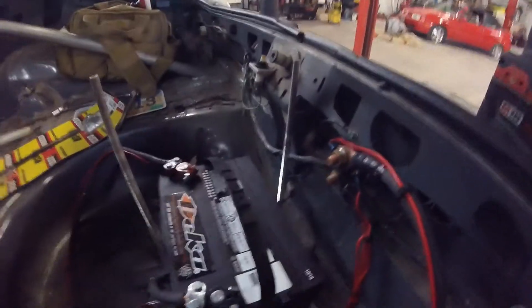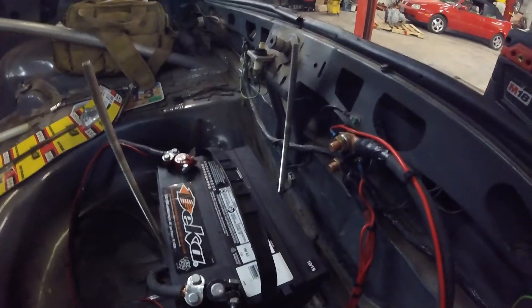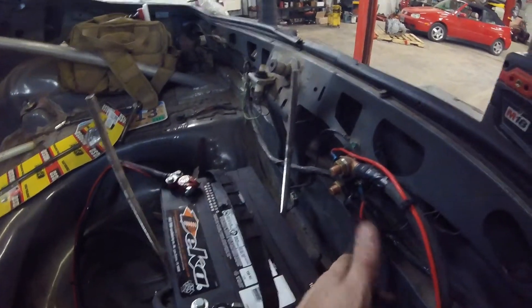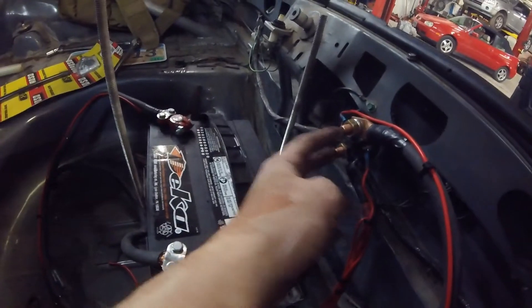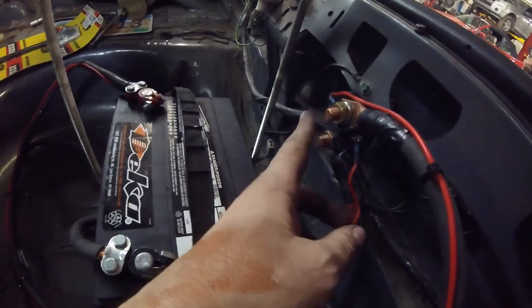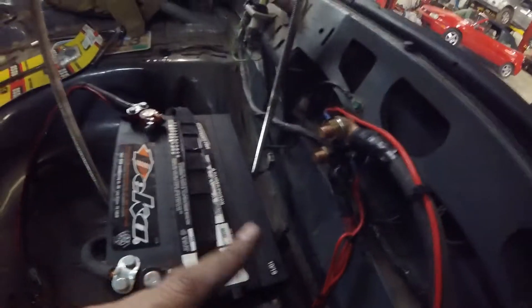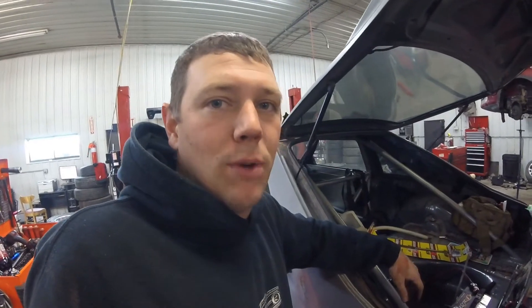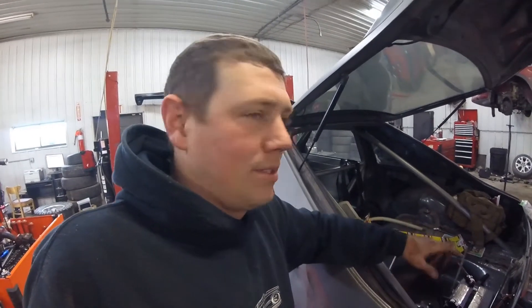When you are wiring up a cutoff switch, there's two different styles of switches you can use. If you are running a full-on race car and you have no alternator, all you need is one with the two battery posts. They also make one for the battery cutoff to the car, and right here is the activation wire for your alternator. The way this works is when the switch is off, it breaks the connection between the activation wire, the alternator, and the battery. When it's on, it gives power to the car and also out to the alternator. The big thing is to make sure that if the car is running, it shuts it off. If you don't wire this up right and you actually need it in an emergency, the alternator will keep the car running if you have it isolated on the battery side. So it's very crucial that you get this done right.